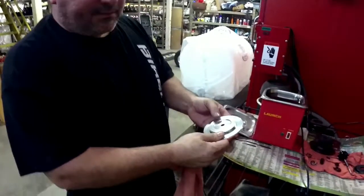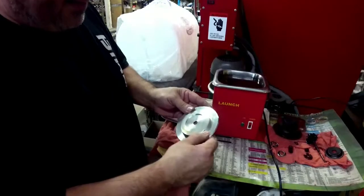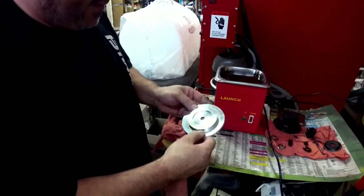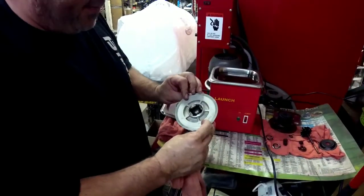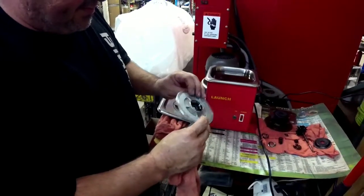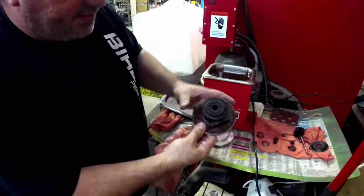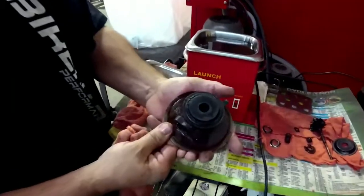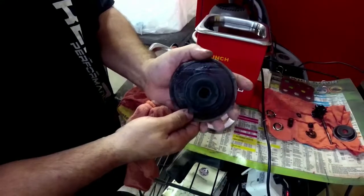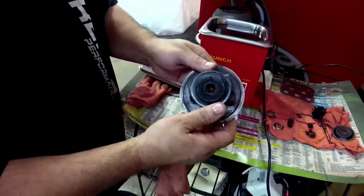All right, farmer, what's the verdict? How did the ultrasonic cleaning work? It did all right on the lightly soiled stuff, but anywhere where there's heavy carbon deposits, it didn't really do anything. So on the turbo where it was all coked up from the oil, it's not real good - still about the same result. Heavy carbon deposited in the oil galleys, so we're going to have to get out the pick or try something new.